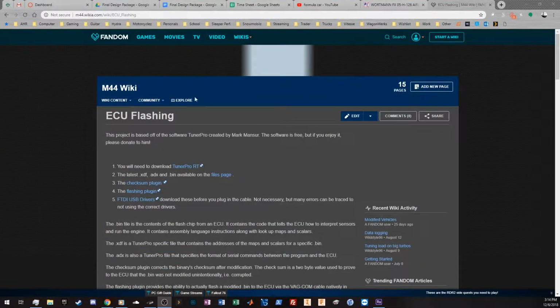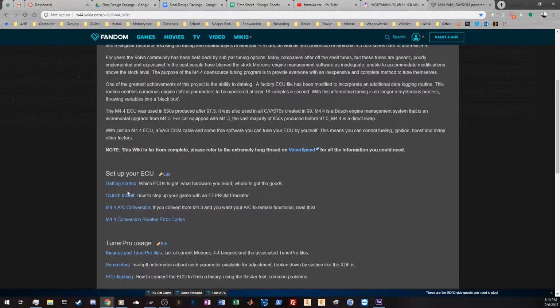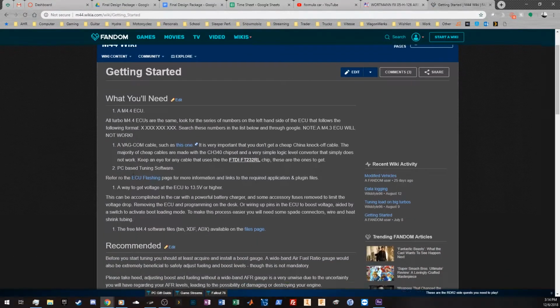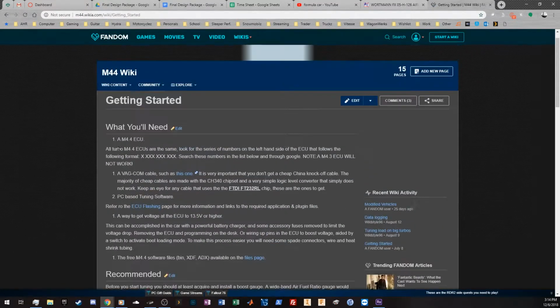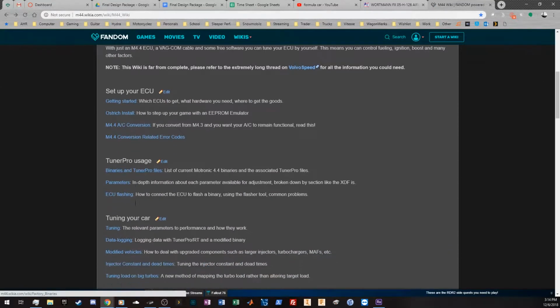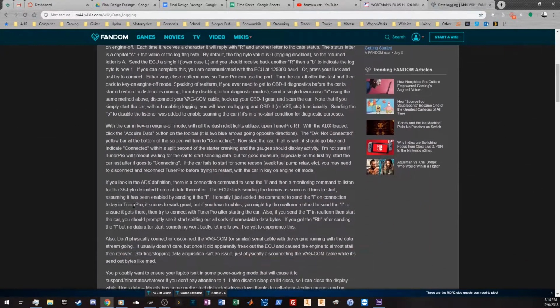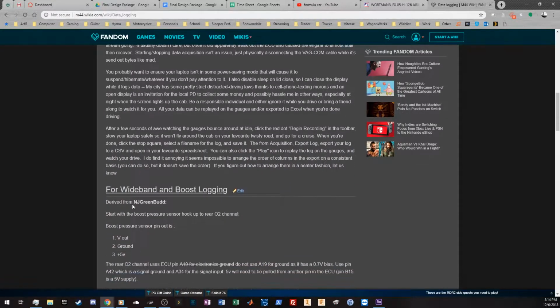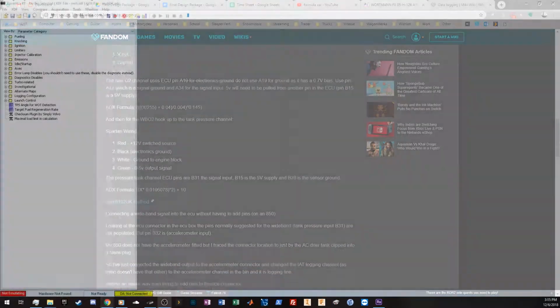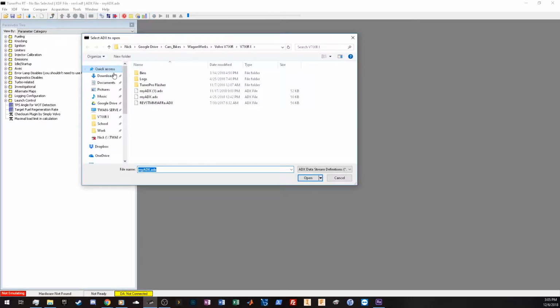This M44 wiki is a great resource to find all about this modified ECU and TunerPro data logging setup. It'll walk you through all the way from which ECUs you should get, the basics of tuning, data logging, and some analysis on that as well. I'll include a link to this website in the description. TunerPro itself is a very simple and powerful free software for tuning engines and data logging as well as emulation.